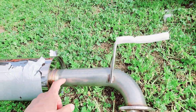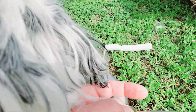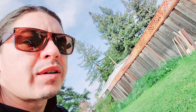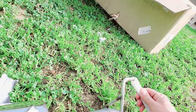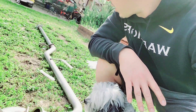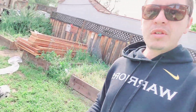The canister mufflers look tacky to me, but this is the part that's going to make this exhaust system good. The piping looks nice — it's mandrel bent tubing, good welds, and it truly is stainless steel. The brackets on here go right into the factory mounting points, which should make this kit very easy for anyone to install. Get a buddy, knock it out — shouldn't be tough at all.